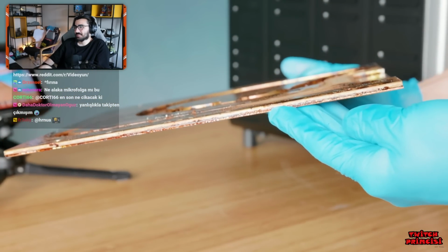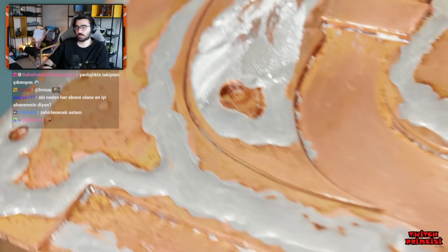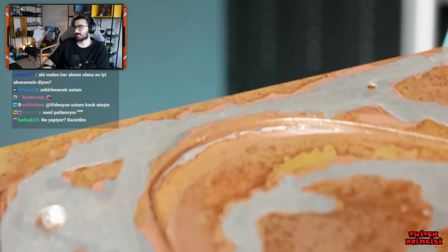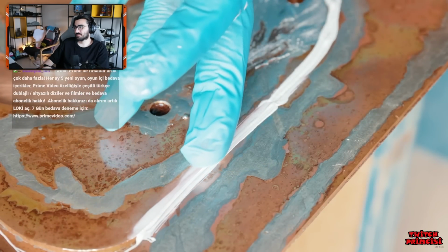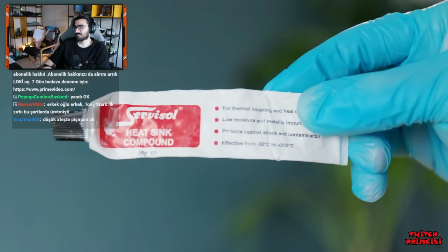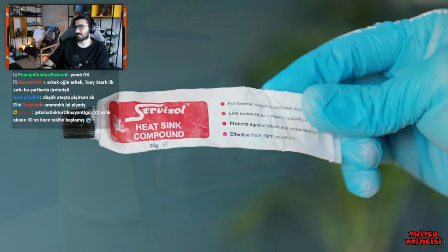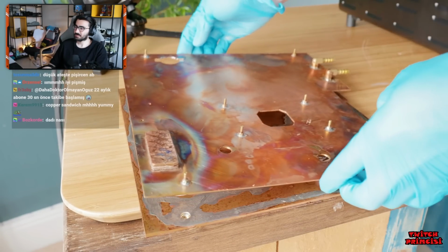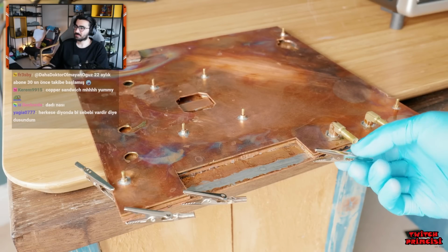It's a bit gooey from the flux, but the 2 layers are definitely joined together now. One thing I realised though is that it would have been easy for the channel to have filled up with solder, which would have blocked it. So to protect it from the next batch of soldering, I'm filling it with a type of silicone grease. I've had this stuff for years as a cheap thermal paste, but from my experiments it resists these temperatures well enough, and more importantly it dissolves in alcohol, so it should be easy to remove afterwards.